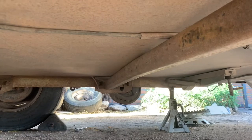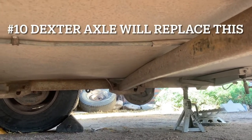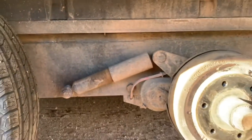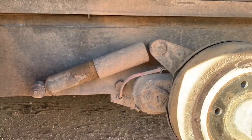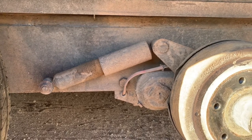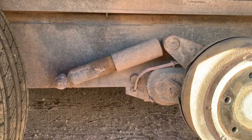As you can see from the other side, this is the square tubing. There's a number 10 and number 11 axle. The best I can determine this is a number 10 because it's less than a three-inch tube. We'll be putting a lift kit on this bad boy too because this torsion setup is wasted. The square bushing inside there is just rotten, and this sucker rides way too low, even lower than what the Airstream should be riding at.